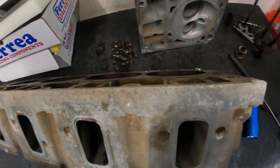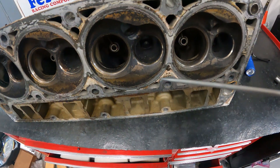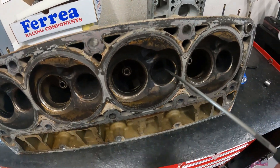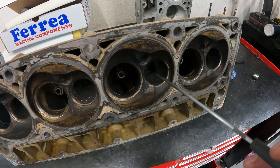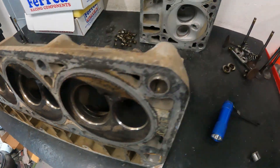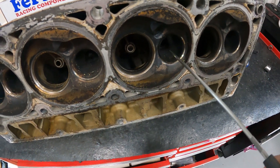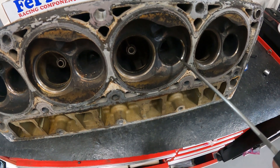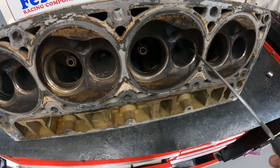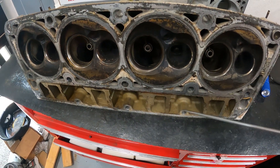Let's look at the exhaust side. Exhaust is obvious — there's more carbon here, and the exhaust side typically builds up no matter what the engine is. Sometimes with the rings not seating, you'll have oil through here and it really cakes up. These really aren't as bad — I've seen far, far worse, especially if you take apart some of the old small block Chevys. But it does build up. Kind of nature of the beast.